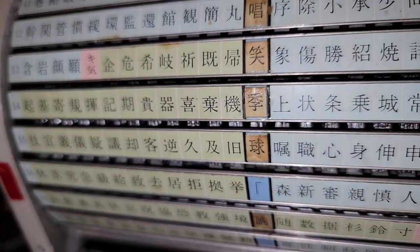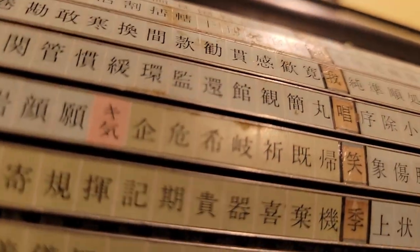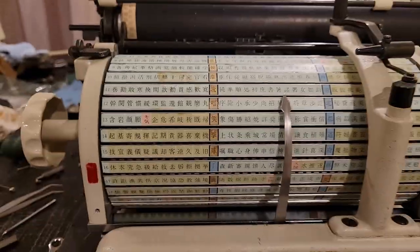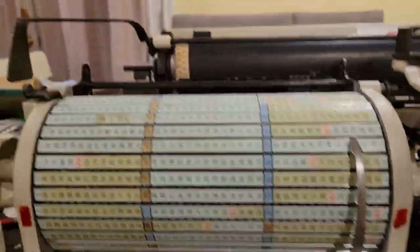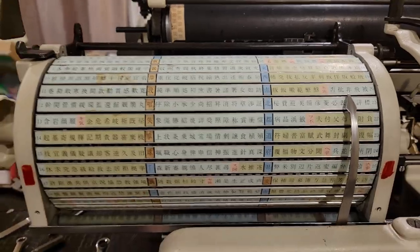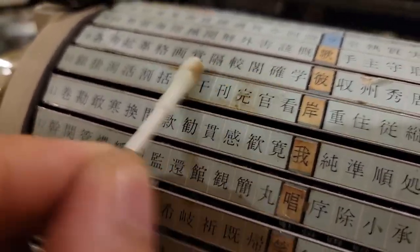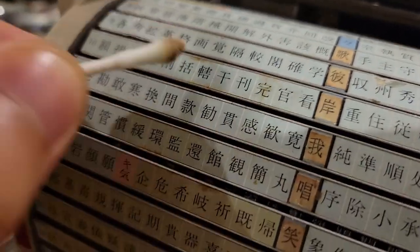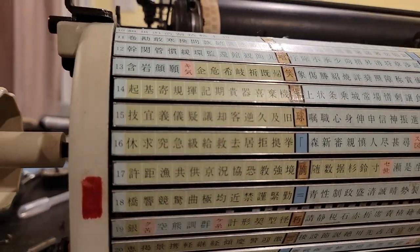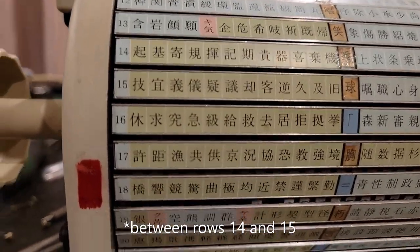Some of these look quite clean while others have a bit of thickness to them — same thing with the characters themselves. Not as easy to see in this lighting. Given that, probably the best I can do is just do a simple wipe down with a light detergent, just to clean off whatever dirt, and maybe hopefully allow these legends to pop a bit better. It seems like some Simple Green, diluted, is able to do the trick. Fortunately it has no effect on the actual pigments underneath. You can kind of see a slight increase in brightness after cleaning off that thin layer of dirt.